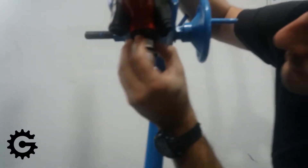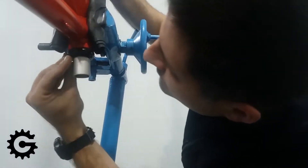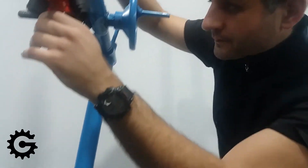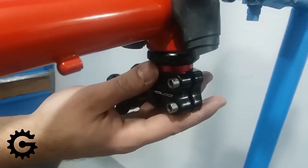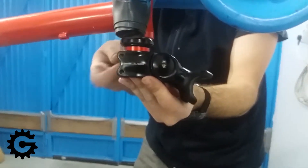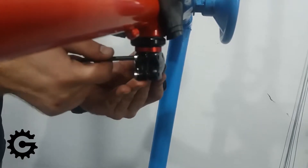These bearings usually have some sort of dust protectors and they should be placed like they came from the factory if the headset is new. There is usually a link with instructions on how to assemble it, and I will also add a link in the video description from my website where that is shown in an expanded view. Here I am just placing it hand-finger tight and tightening the pinch bolts enough to hold it all in place so I can turn the bicycle around. It also needs the top cap in order to achieve proper optimal preload.